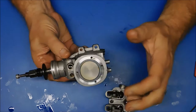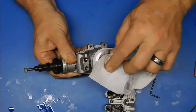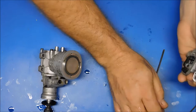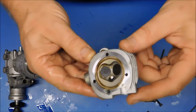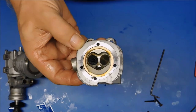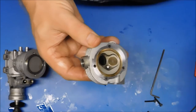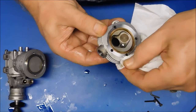What I'm going to do now is a reveal on the valves, because I've seen too many times with a four-stroke engine that you can have a really nice clean-looking piston and that doesn't tell you much about run time. It's really the valves that tell you more. Let's look at our valves — the all-important reveal. Very nice. Exhaust valve — I can feel a little bit of carbon residue on it. Intake valve looks basically brand new. This is a pretty low run-time engine in my opinion. Let's look at this exhaust valve stem.